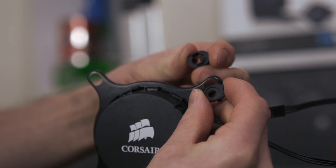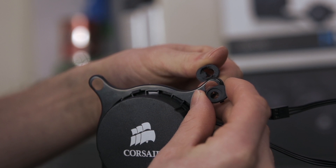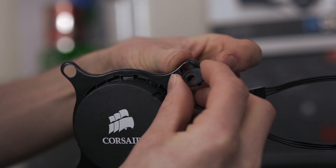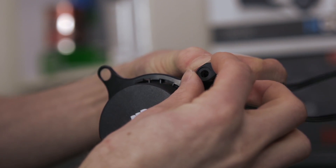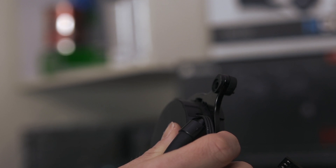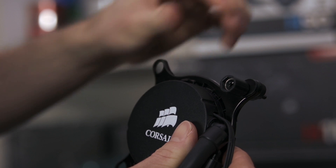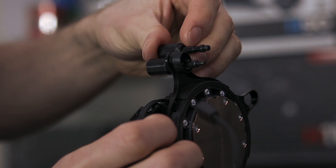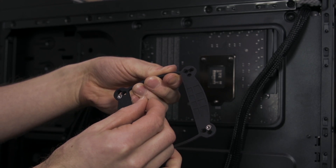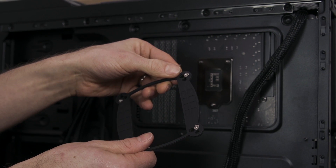This is one step that can be a little tricky if you've never done it before, but these plastic pieces can either be installed this way for LGA 1366 or this way for LGA 1156 and 1155. You position them on the inside for the smaller sockets. What these do is hold the mounting screws into place so that they won't fall out when trying to install the CPU cooler. There are two different screws — one for most sockets and a separate one just for LGA 2011. The back plate is standard for multiple sockets, and we'll be using the 1156 holes to put the mounting pegs into, because those are the same as 1155.